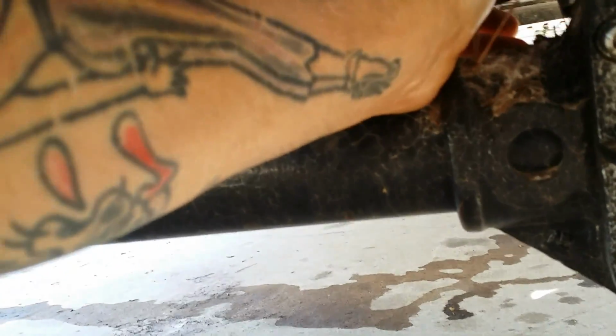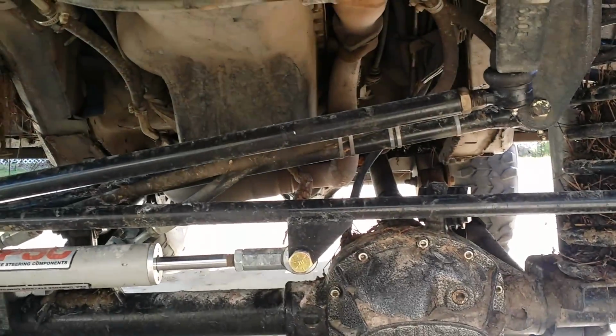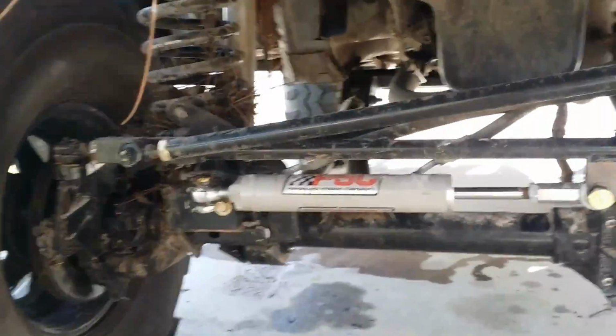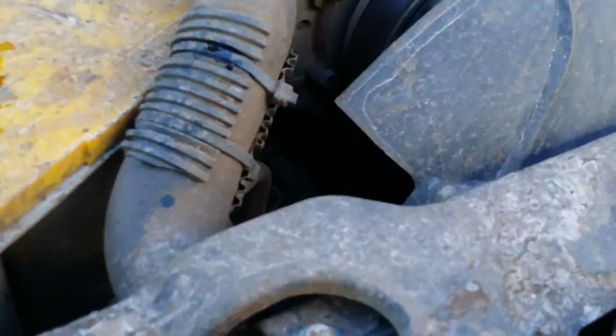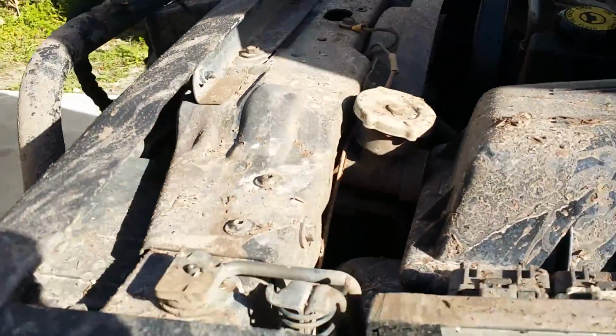That's the noise, guys. Let's get that. I'll get that out of there, but there's a stick rammed up in the dam, up underneath the dust cover there. Huh. That's what the noise is, so it ain't my alternator. It was still charging. It was making a little zzz noise on the way home. I thought it was an alternator, but it wasn't. That's a brand new alternator.